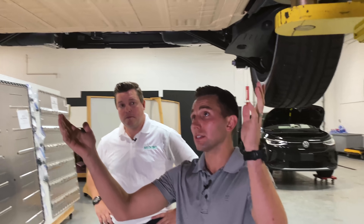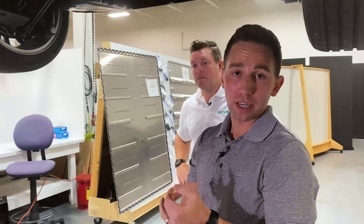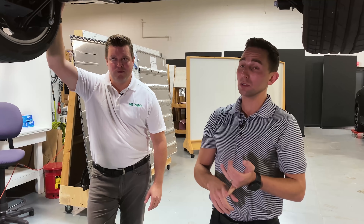The way that BMW utilizes this area is always interesting. One of their examples — I believe the latest gen 5 Series plug-in hybrid — they actually took the packaging space where the fuel tank was and put the battery pack there. Then they took the fuel tank, converted from plastic to steel, and mounted it cab-inside on top of the load floor. This keeps the battery pack — which is always full in terms of weight — down low, while the tank, which is often less than full, goes higher, improving their overall center of gravity.